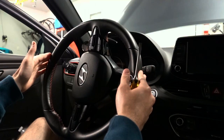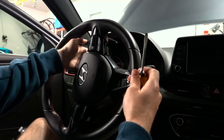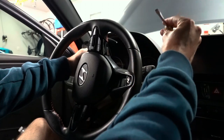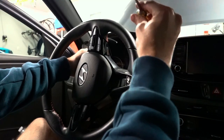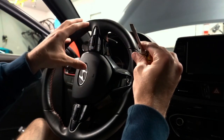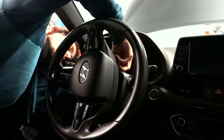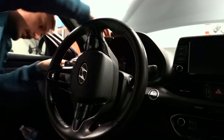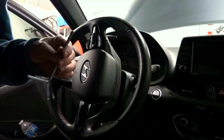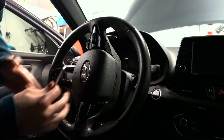To remove the airbag and the steering wheel, turn the wheel 90 degrees off center in either direction. There's a little tab behind the steering wheel that you can fit a flathead screwdriver into — insert it towards the top and pry downwards, and it should release the airbag. It's spring loaded, so it should come off pretty simply if you have the tab pulled down correctly. At the bottom of the steering wheel there is a little pinhole — use an Allen wrench, press in, and that should release the last pin and free the airbag.